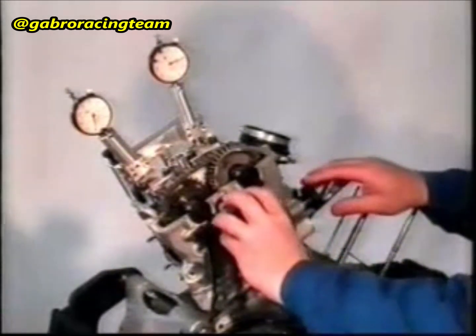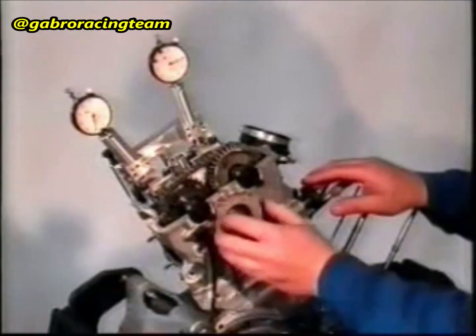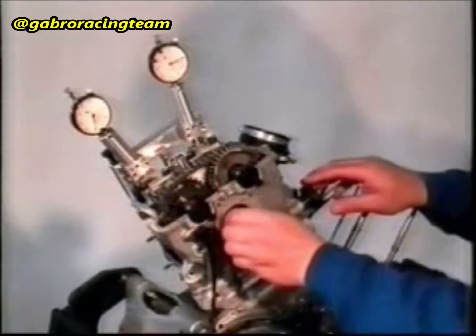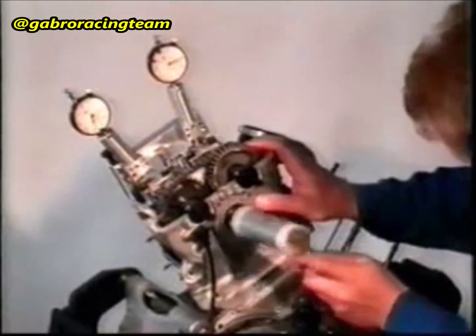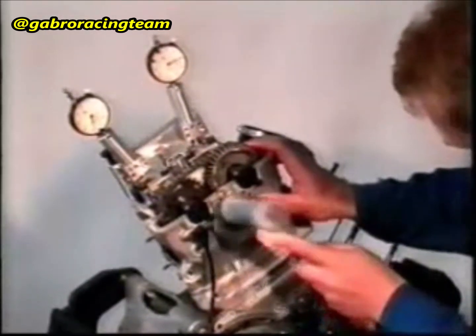Lubricate the upper countershaft housing. Apply Molykote 111 to the O-ring. Check that the bearing cap pin is fitted into the head. Insert the upper countershaft together with the bearing cap into the head. Check that the mating gear teeth perfectly fit into the countershaft teeth.